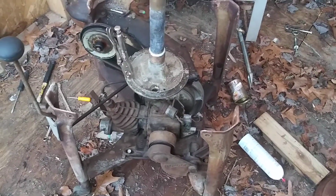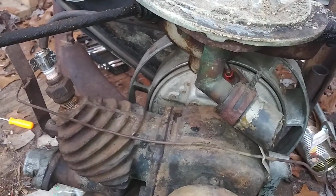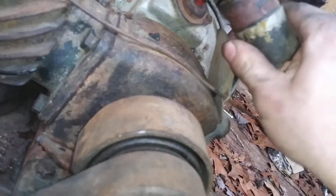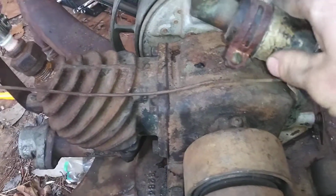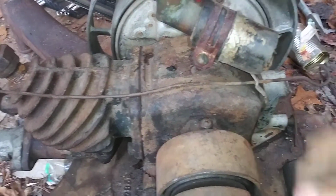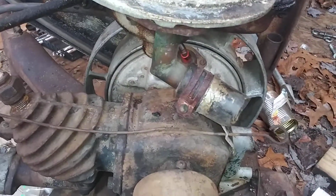And your drain is the same way, except it takes two 7/16-inch nuts here on the bottom to get that off. And then once you get that off, that's copper, it looks like. Yeah, it's copper. That should clean up. Here's probably the original hose here. It's just a regular flathead screw, so we'll take this clamp off here and we can sandblast that and reuse it. And you want to make sure that this drain under here is not cracked or anything as well.